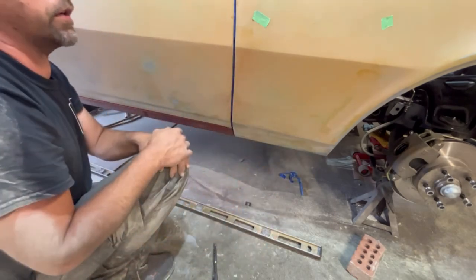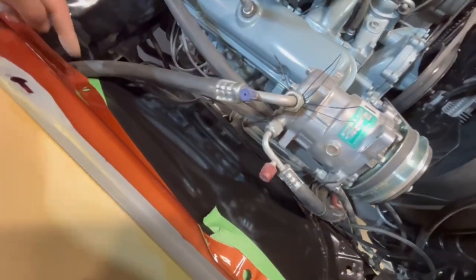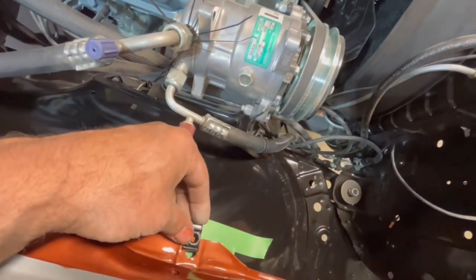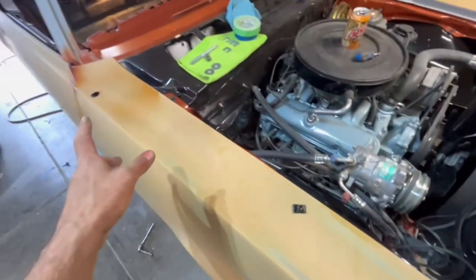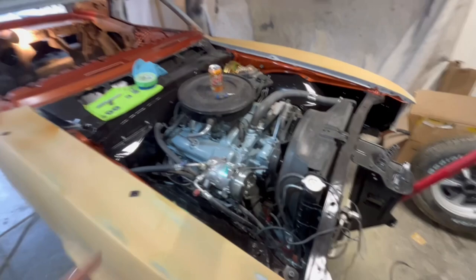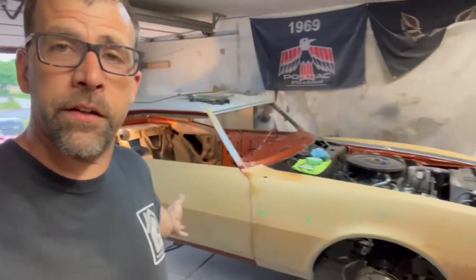All right, that's not going to go anywhere. Now in front of it, that's a different story. Going into the hood area — I've got a couple things I still need to do. There's a nut that goes here and a nut that goes here. I like to refurbish or recondition the original square-shaped nuts — the replacement kits come with a U-nut that looks okay, but these are right in front of your face so I kind of like them to look original. I'll salvage a couple of them and position them into these spots and reuse those so I can get the bolt started. At this point I really can't tighten up anything up front — I'll leave the back tight because I don't want the fender to move in, out, up, and down — but the front, the core support hardware is still loose, and the mounting nuts that hold the inner fender to the core support — same thing, all loose. I need to get the hood installed next, but that's going to be a video for another day. Now with the fender installed, I can go ahead and get rid of the tape. So there you go — fender installed on the Great Pumpkin.